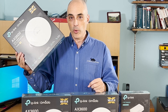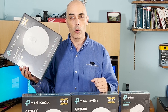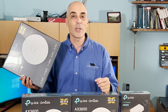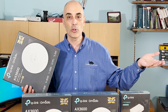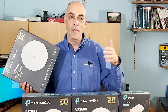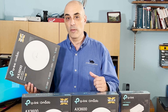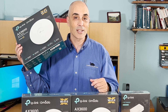Let me explain what an access point is. Perhaps you have no idea what the difference is between an access point and a router. Typically, if you've got a very small environment — home, small office — you would have a router that would have Wi-Fi built in, and what that would do is plug to the internet and through various pieces of technology and configurations, give you IP addresses internally. When you have a larger environment, what you want is not a router — you want access points.